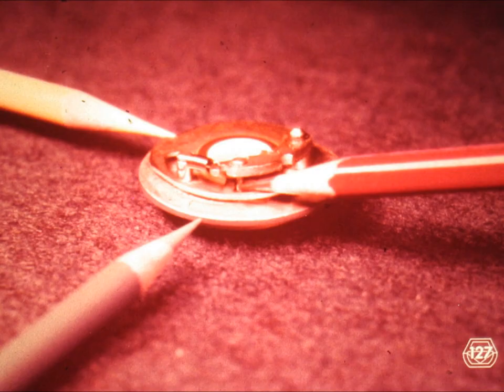Slide number 127. As the cam and the pawl continue to rotate, the pin of the pawl, indicated by the red pencil, meets the edge of the opening in the clutch disc, with the end effect that the pawl is cammed out of engagement with the ratchet, against the action of the ratchet pawl spring, or simply the ratchet clutch spring. This amounts to saying that when the ratchet cam finally stops rotating, because the pawl pin reaches the end of the opening in the clutch disc, the spring is stretched. But a spring does not just sit there and remain stretched — it will collapse unless we hold it in its stretched condition. In fact, it would tend to turn the cam top to the rear of the machine; the point of the cam indicated by the blue pencil would turn to the right in this picture.